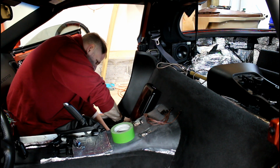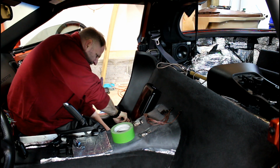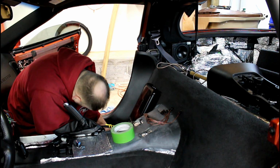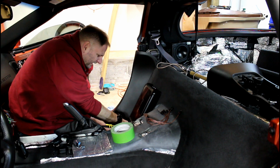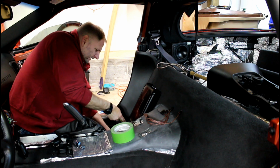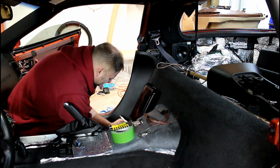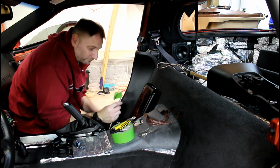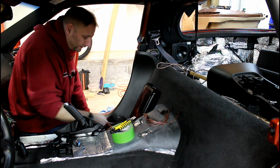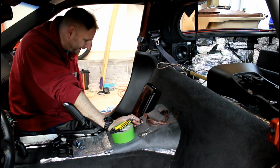What I'm actually doing is I'm going to make 2 cuts. I'm going to have one for the power, ground, and turn on, and then I'm going to have separate for the speaker wire itself. And it may not be wide enough for both of these 4 gauge wires. We'll see. Oh, it is. On each wire, I've got it labeled. 5 speaker wires. Right on. Then it's just a matter of trimming these up, and that's it.